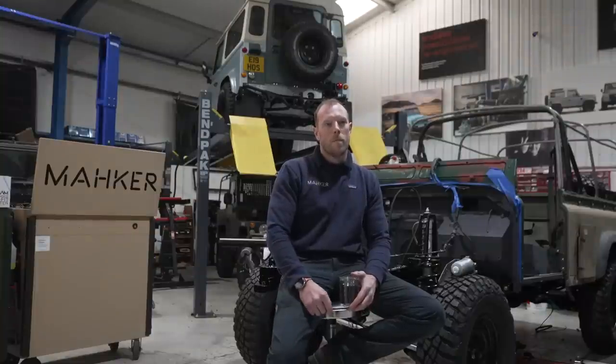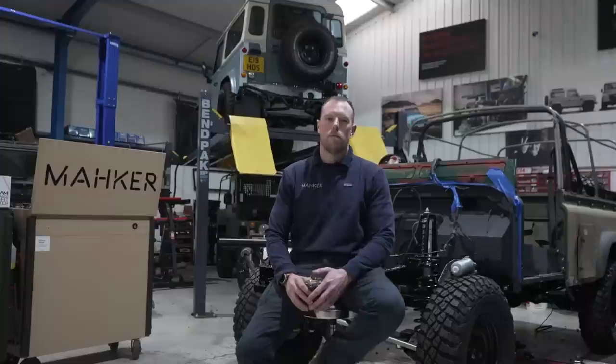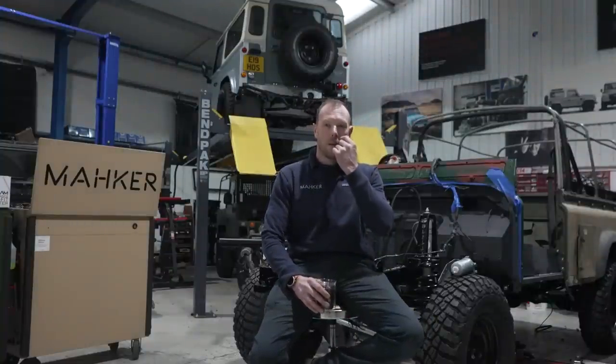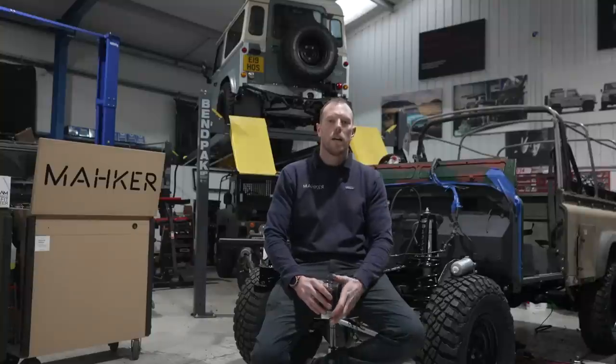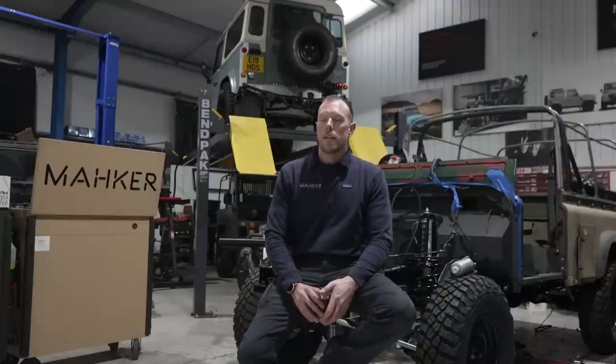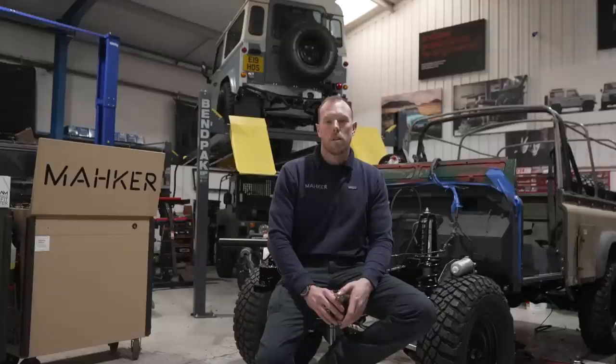Right, so Dave, first one, do you ever consider axle swaps? Say, for instance, one-ton axles from a US truck. So actually, we have done this. A couple of our builds, we did a couple that went over to Dubai. We took axles from a Dodge Ram, so a Dodge Ram 3500. They were, from memory, Dana 60s, a Dana 60 front, a Dana 60 rear, and we can do that. The bracketry is quite tricky, but we can most certainly do that.